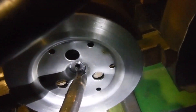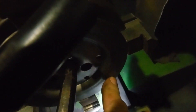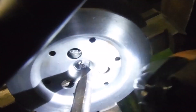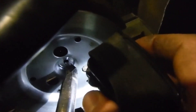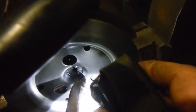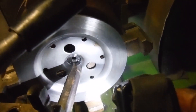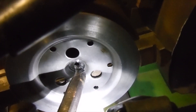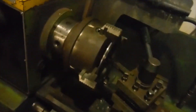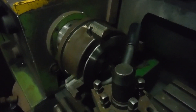I've had the pressure plate in the lathe and clocked the working face to make sure it was spinning true. Sure enough, the cutting tip of my tool was removing material — taking away a high spot that was in there. Now I've hopefully got it machined flat and even, and I'm going to try the pressure plate again by hand using thumb pressure to see if it lifts more evenly than before. Hopefully that may be, if not the entire key to the problem, a major contributory factor.